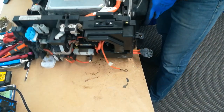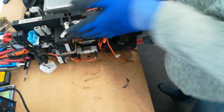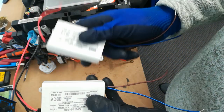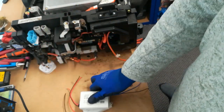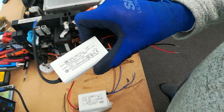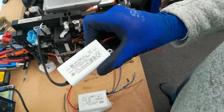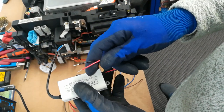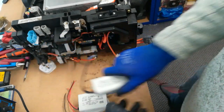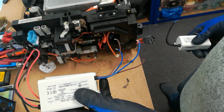Key things to remember: safety first — make sure you've got your gloves on and the switch is in the off position before you start. All you actually need are two 350 milliamp drivers for the high voltage side, and one 12 volt DC one amp driver for the fan. If you've got any 12 volt wall warts — standard 12 volt adapters of at least 9 to 12 volts at one amp, like old router power supplies — you can use one of those. The two APC LED drivers are the more specialised items you'll likely need to buy, as they're constant current output which means they won't overcharge the battery.